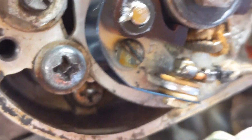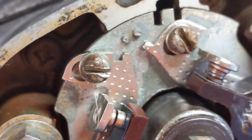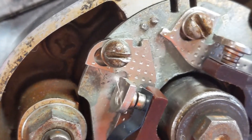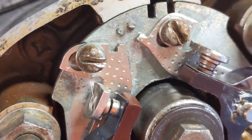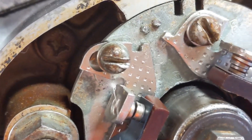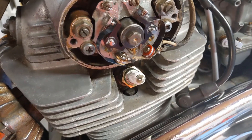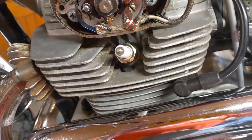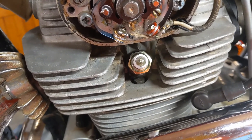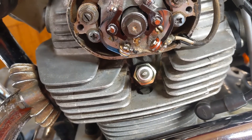There's that screw right there and this screw here — there's a slot up here. There are little pegs along with little slots cut out of the points that let you get a flat-tip screwdriver in there to open and close the gap. You're not moving the phenolic base center — you're moving the actual points where they mount on the base. I also put the spark plug back in as soon as I found the compression stroke, just loosely finger-tight, so no debris gets sucked in while working with the crankshaft.